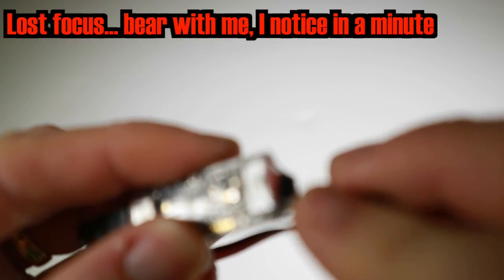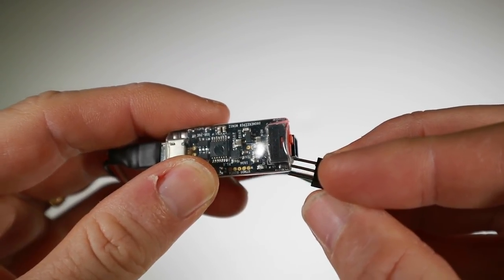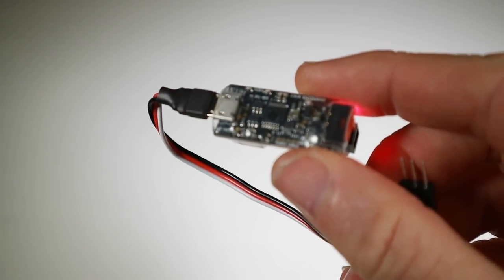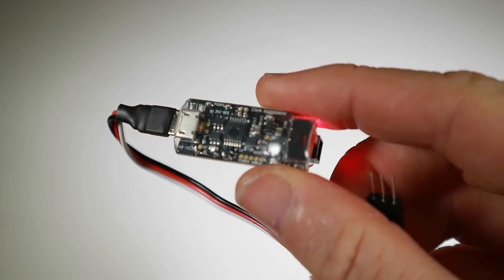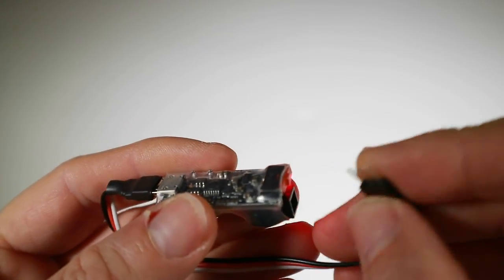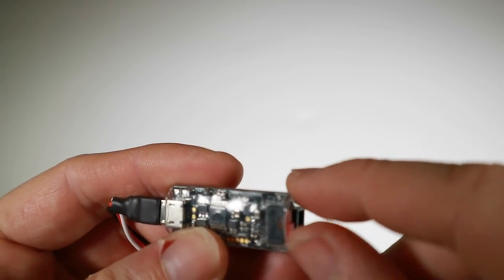To set the ultimate timeout, you hold on here for a couple of seconds and this little LED turns on - you're now in setting the timeout mode, which defaults to 20 minutes. You can cycle through: one beep for 20 minutes, two beeps for 40 minutes, three beeps for 60 minutes. You might need three beeps if you're in a plane or something, but on a quad I tend to think a single 20-minute beep is fine.